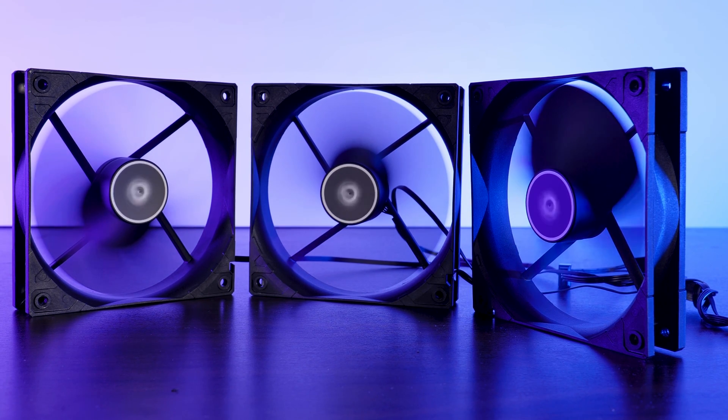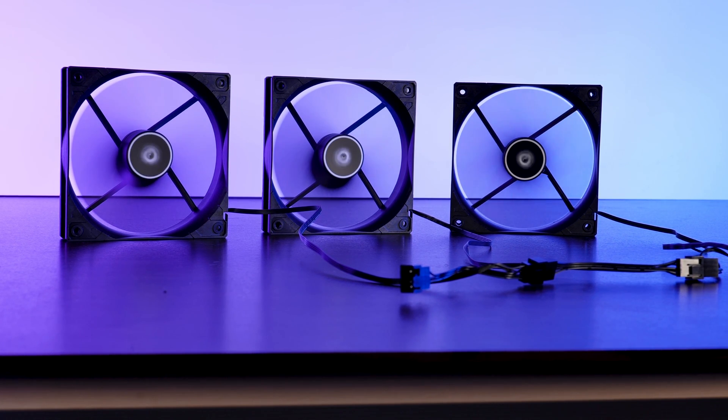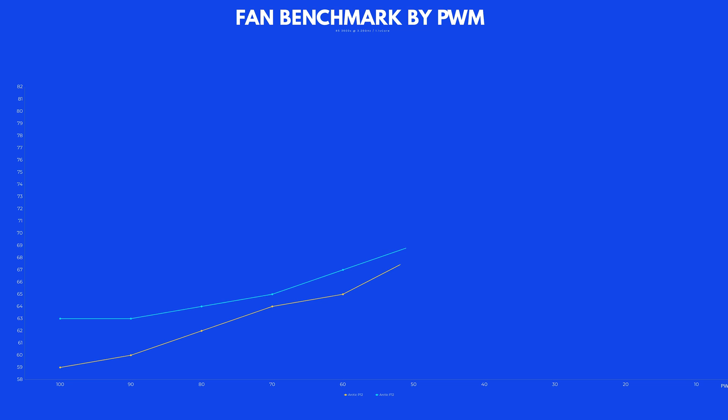The low fan speed and high efficiency of the F12s point to one thing: an F12 is only meant to provide cold air, whereas a P12 is in theory very capable of cooling stuff. But this also means our first benchmark was highly biased towards the P12. So we changed it up — we reinstalled the fan on top of the be quiet! Pure Rock Slim and let it spin at 20% fan speed. Now the high static pressure of a P12 is not that much of a benefit anymore, because the CPU fan handles the heatsink and we're just looking at how much air the case fans can provide. While slowly reducing fan speed, the P12s started at 59°C and ended at 81°C. As expected, the F12s started a bit higher at 63°C, but as we reduced fan speed their efficiency caught up until they overtook the P12s at 30% fan speed. At really low fan speeds, the F12s do a better job at providing and circulating air inside the case.